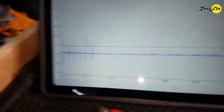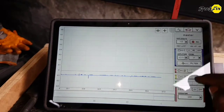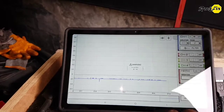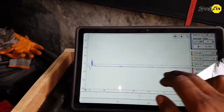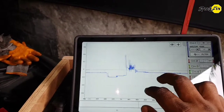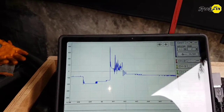I am going to record the waveform in automotive mode, so I can analyse it later. I used a 2V scale and 125 kilo samples per second settings to capture this waveform. Look at that — it has captured a nice and good-looking secondary ignition waveform.